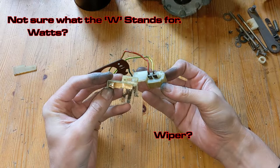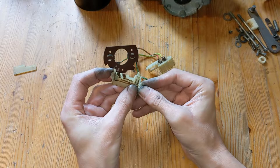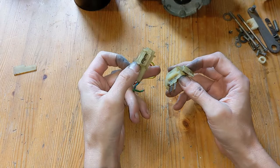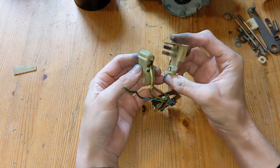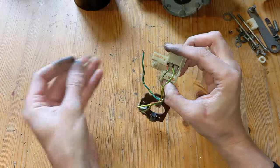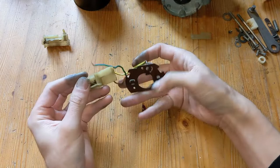This park switch is pretty much unobtainable now, and it's also broken. Apart from the fact it's broken in half, the pin on the switch is bent, which means it keeps sticking in the housing. I thought about modifying the more common clip-on switch to fit, but I thought I'd have a go at repairing this one first. I should at least be able to glue the housing back together easily enough. These brushes aren't available anymore either — the brushes for the 14W are though, so I'll make do with those.